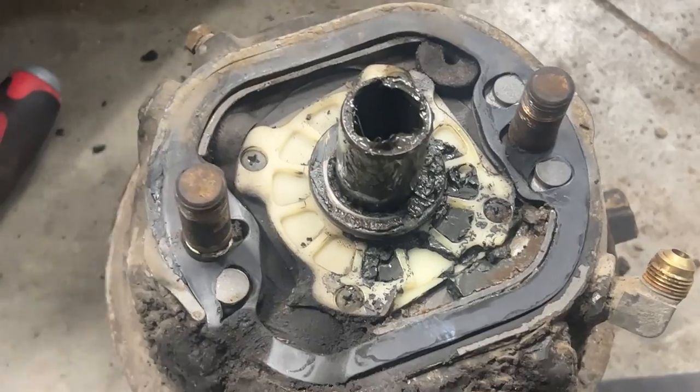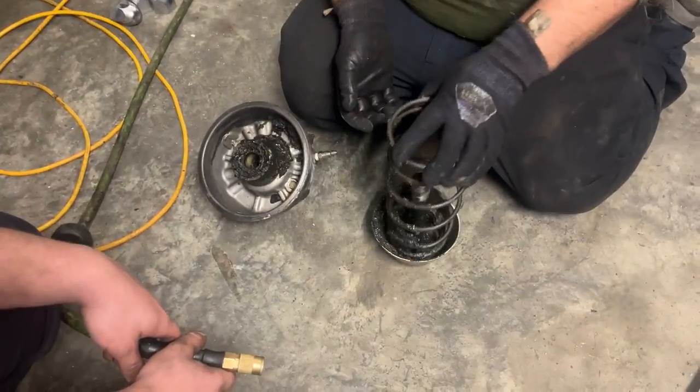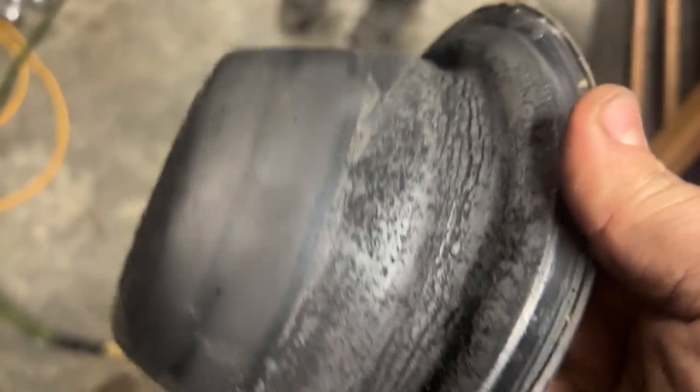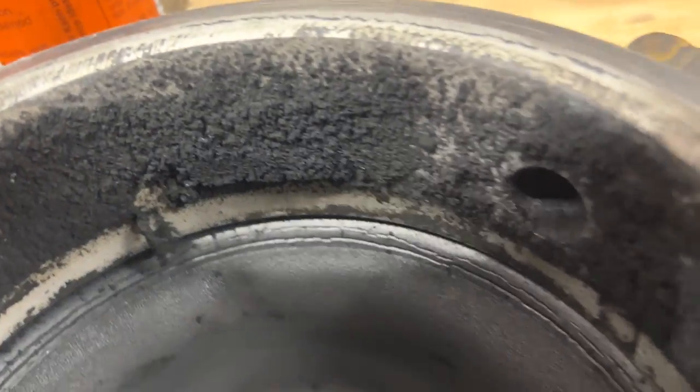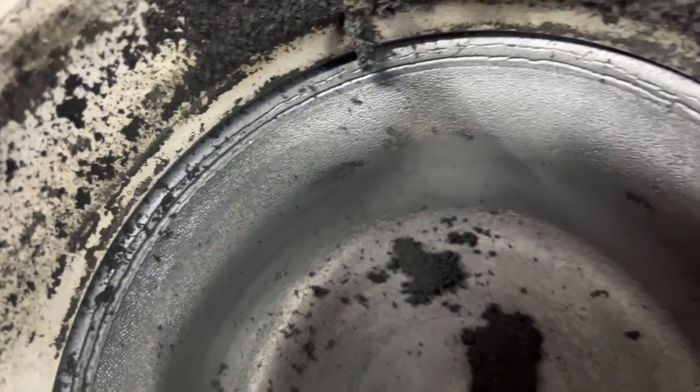Smell that grease? Yeah. I think it's got the same problem the last one did. Somebody over-greased it. That's my guess. Think they over-greased it? Yeah. The diaphragm. It's definitely bad. Look at all this rubber powder that's inside here. That's how much it's all worn. That diaphragm's got some good creasing in it too.